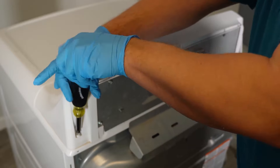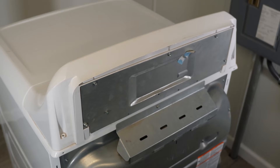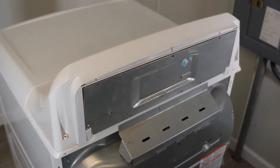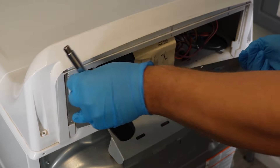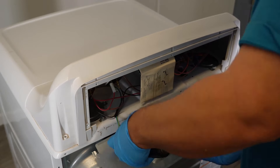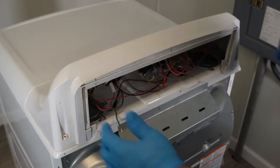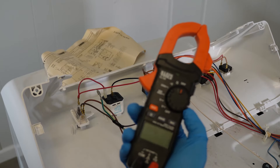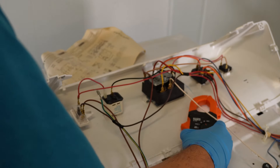Now let's get to the control system. Take your screwdriver and remove the two screws on each side of the plastic unit — they are a quarter-inch hex head or you could use a Phillips bit. Next, remove the four screws that hold the metal back on, the same style as the two you just took out. Once you have these four screws out, slide the panel up and then out. Note the schematic located here, which will have technician info. There's also a green grounding screw that needs to be removed before you can fully take the panel off. Once you have that quarter-inch green grounding screw out, pull on the panel to dislodge the console from the metal top. You need to press it to the rear of the machine and then up and pivot it out.